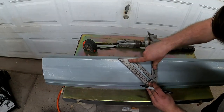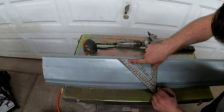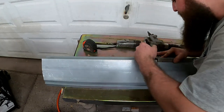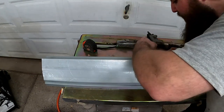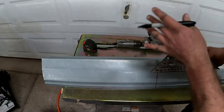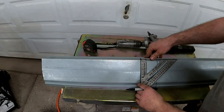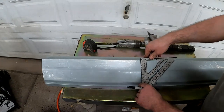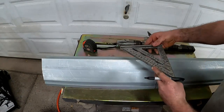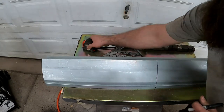On contour parts it's a slight bit harder, but you can still get a rough idea of a straight line for what you need. Down here you can do the same thing — keep it on the lip, bring it up — and it gives you measurements and angles. Now we're going to go in about a half inch. I like to just use regular numbers because you can actually see them, so we'll go about two and five-eighths — that will be our bending point.